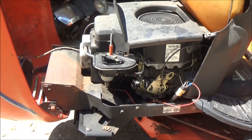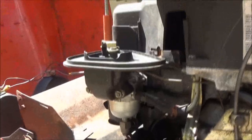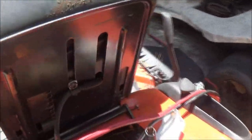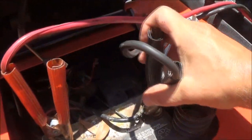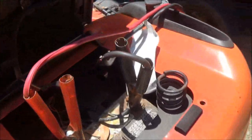She does run. I'm going to let it run a minute and we'll see if we can find where the leak is he's talking about. It's not leaking yet, it's not running right, but I noticed this thing is not charging - because if I take this off it stalls out. That's telling me one thing for sure: the system is not charging.